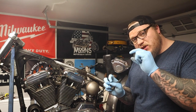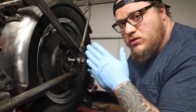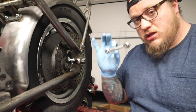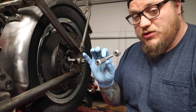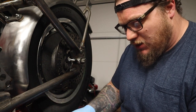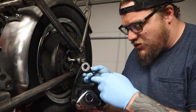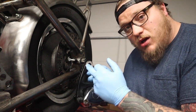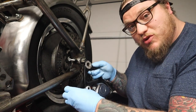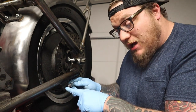So this needs a little bit of tweaking before it can get put on. Back here at the rear axle — in the box that comes with the hardtail, there's a bag full of hardware, and in that bag is this little heim joint. This looks similar to the one I used as a shift link on my Dyna, but it's not. Essentially, this brake caliper gets mounted through the axle. There's a schematic that comes with the instructions — you're going to drill and tap a hole on the left side of the caliper mount, and basically mount the heim joint on here. The other side of the heim joint is going to go through the brake tab right here.